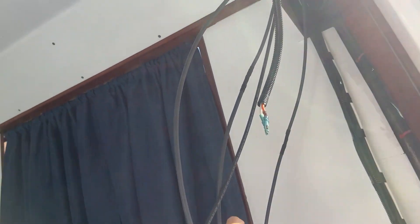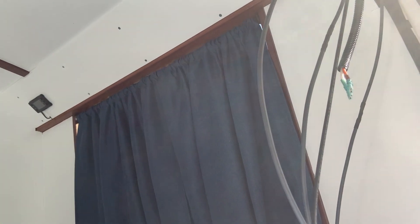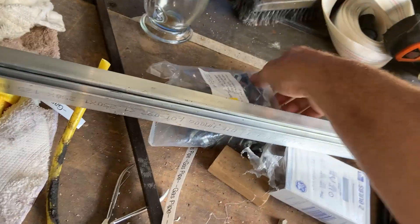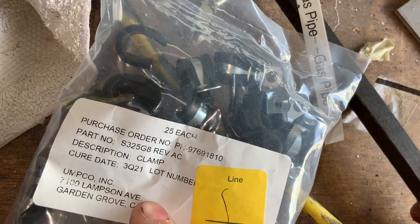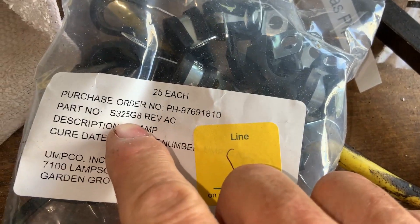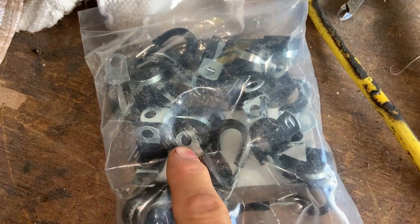Let me turn this off — I'll show you what I mean about that. I left myself excess wire to tuck up in there. I'm going to put all this back together with my 12-volt power ports, one on each side. This is my two solar inputs here. And then I got to go on the roof and attach the clamps. These are from McMaster-Carr. Looks like that's the part number. These are half-inch cable clamps, with a hole big enough for quarter-inch screws, which works perfectly.